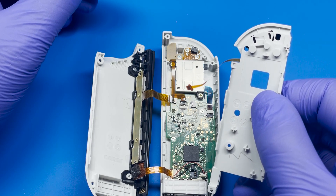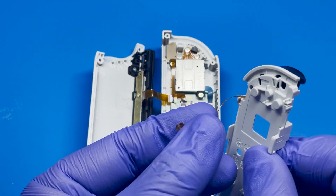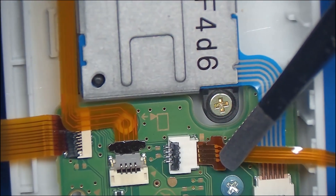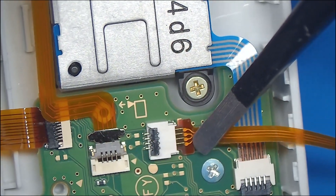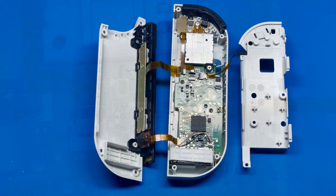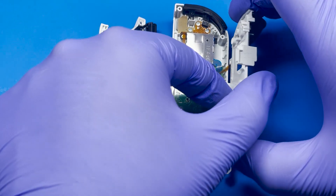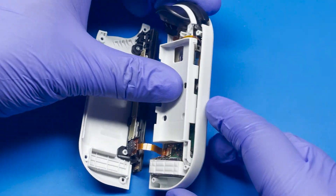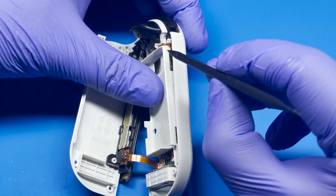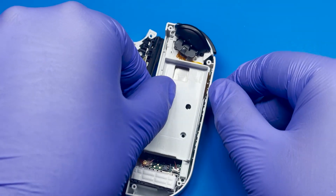We're going to put this casing back on. Normally you don't take this off, but in case you do, you're going to want to connect this into this slot right here. The pins are going to be facing up — shiny side up — and we simply connect it here. One thing I want to point out is that when putting the housing back, you can run into issues with this ribbon cable if you don't tuck it in properly. Sometimes this piece of ribbon can get caught on the outside of the plastic. You want to make sure it's going inside this groove and not sitting on the outside, to prevent any potential damage to that cable.